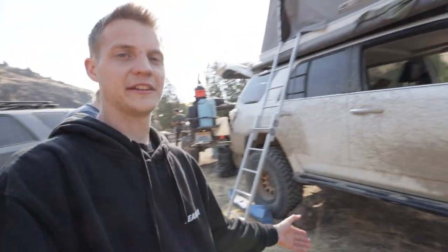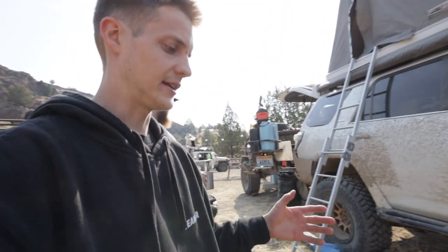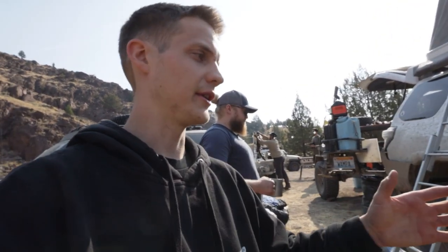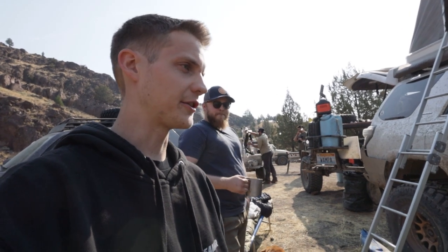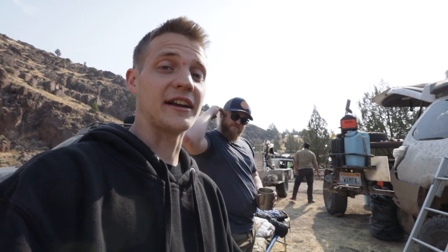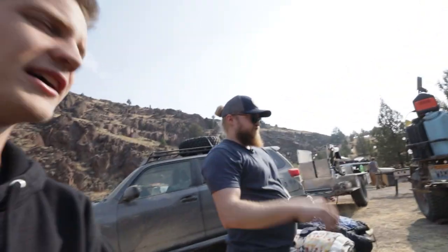This guy is talking about some good stuff here, because when you start lifting these trucks and you're putting on long travel shocks and having all this articulation, the suspension geometry is completely off and you'll start to get roll steer. The links are too short in the rear and they'll start binding up and pulling that drive shaft right into the gas tank skid and then into the gas tank. I'm actually on my truck right now that I'm getting rid of, and if I were to wheel it again, it would probably get a hole in the gas tank for that very reason. So the Johnny joints and adjustable links that Cali Fab does are very cool. That's very neat to hear.